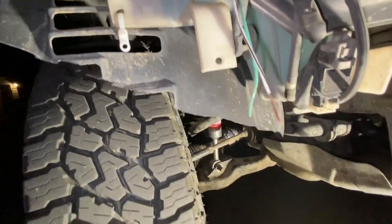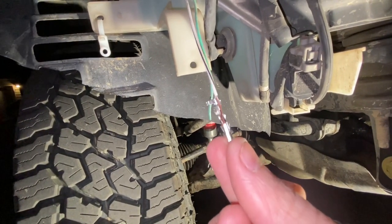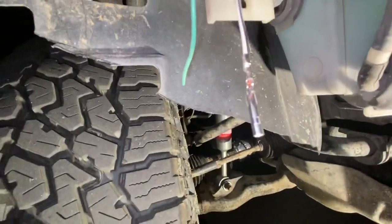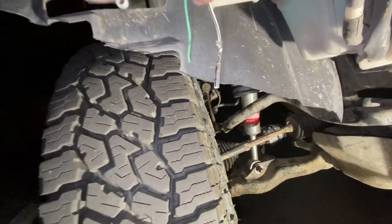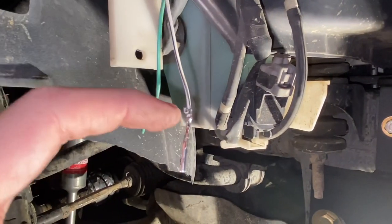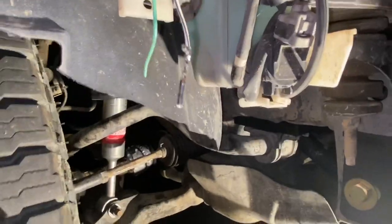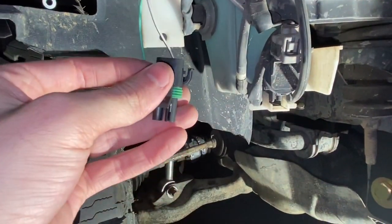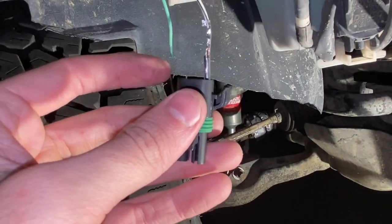Twist up the wire a little bit and then you have these little inserts - kind of just put them around and wrap these guys around the wire. It should look something like this - it ain't pretty but I'm not good at this. Basically like everything else, I just want to show you that if I can do it, you could probably do it. Clamp the top piece around the wire part just to hold it on, then get really good contact and try to leave this alone. Then feed this connector up after inserting these little rubber things, and then you have yourself your non-OEM connector.